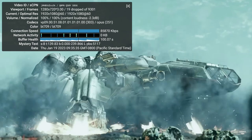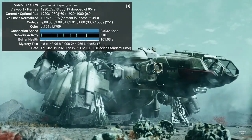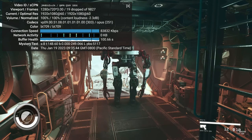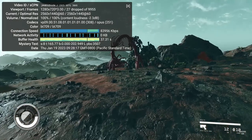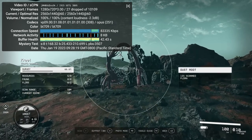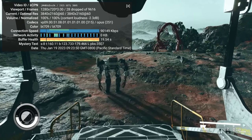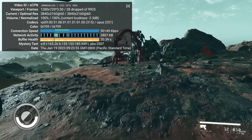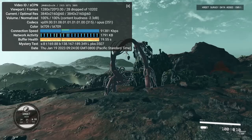With YouTube playback, I haven't yet come across a budget unit that doesn't drop frames running with a 4K desktop resolution, and the N100 isn't any different. At 1080p 60fps, 19 frames out of 10,000 were dropped. At 1440p 60fps it jumped to 27 frames. At 4K 60fps, 28 frames were dropped out of 10,000 — still a pretty good result. In all three scenarios, most frames were dropped at the beginning after hitting play, which is most common.